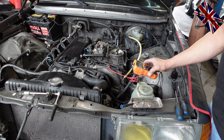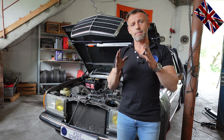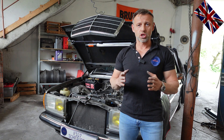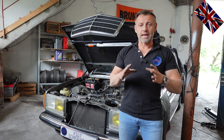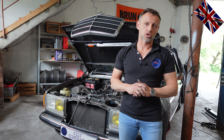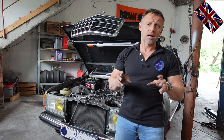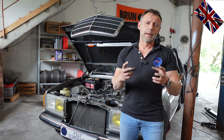Our accomplishments: checking pressure of fuel at the WUR. If results differ significantly from the specifications, please listen up — this is off-the-record good advice. Scenario 1: engine cold and fuel pressure significantly above 1 bar (15 psi) — then disconnect the reflux lines. Over the years, residue and fuel gunk can clog and block the lines. Unbolt and dismantle the WUR. Scenario 2: engine cold and fuel pressure way below 0.5 bar (7 psi) means a leaking WUR — unbolt, dismantle, repair with the repair kit, or replace. The link below shows the video of unbolting, dismantling, and repair of the WUR.